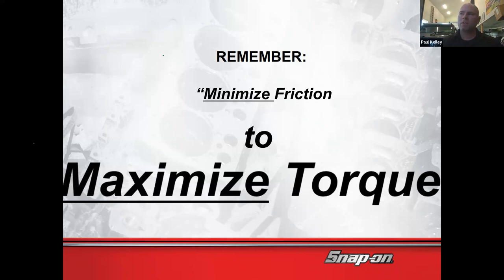So if the manufacturer says one time use, you trash them. However, Toyota is very notorious for having you measure the bolts. Don't necessarily condemn them, but here is what Toyota will do. I don't think I have any torque-to-yield bolts right here in my toolbox, but I can give you a visual.